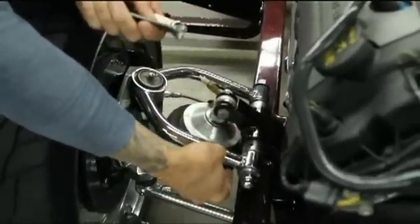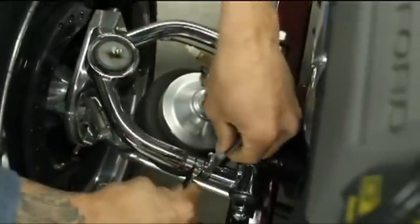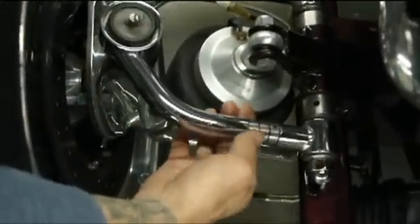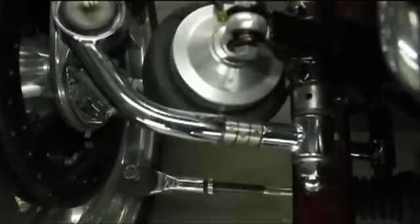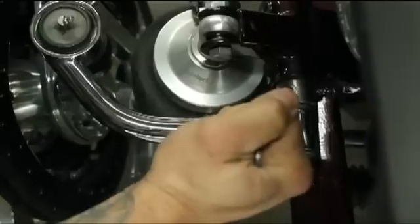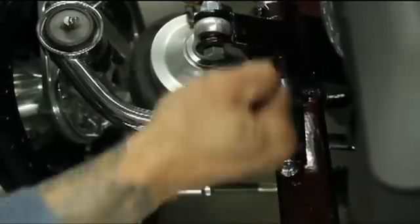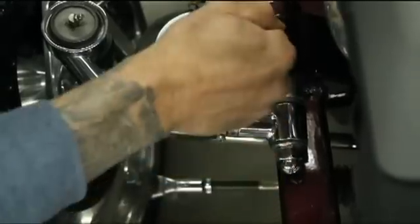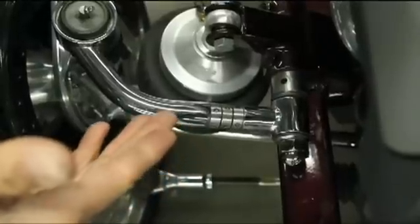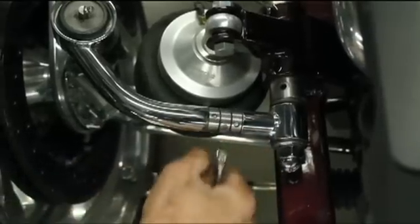The only time you'll really need two jam nuts is when they're locked in place, maybe to hold the center one as you break free your jam nut. Once you have it broke free, you can see they will both spin in the same direction. All you do is lock your spanner wrench in and you turn it whichever way you need — whether you're trying to get negative or positive caster, negative or positive camber. As you can see, the weight of the vehicle is on the ground and I'm adjusting it.